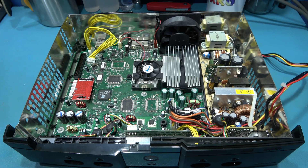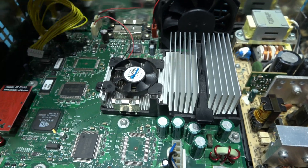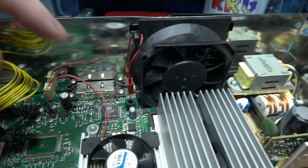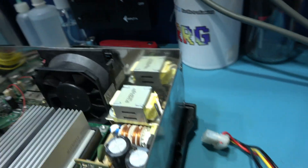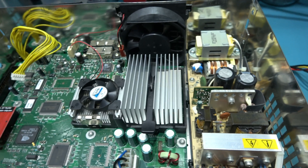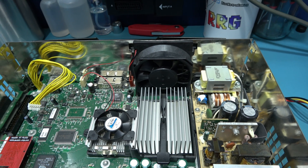What I've got to do now is remove the old fans. To remove the GPU fan it's very easy — there are four screws, one here, one here, one here, one here. Remove those, take the fan off, remove the clip — you're done. The system fan is a little bit more tricky; there are no screws holding it in, it basically clips in. There's a clip on this side and a clip on this side. Be very careful near the power supply — if you put anything metal there you are risking it. But they're not too difficult to get out.